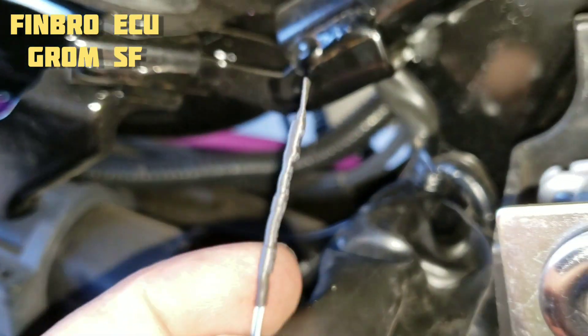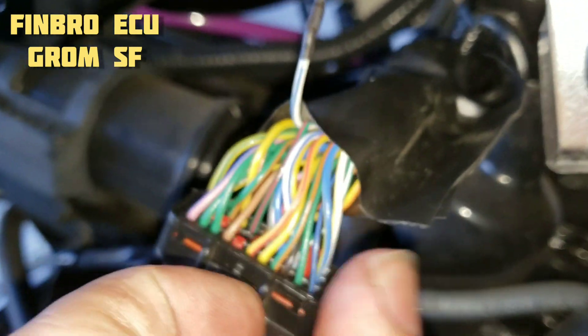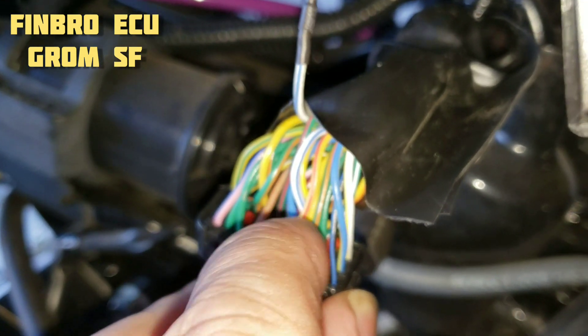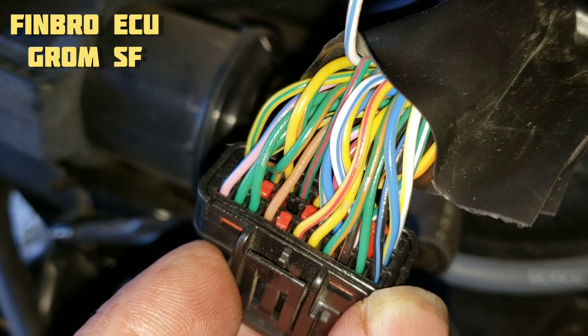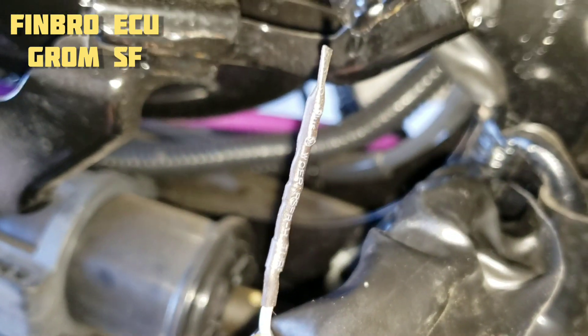We have it heat shrunk. We were able to pull the pin just by grabbing with some pliers and pulling slowly. It's right below where this red plug is in number seven. That empty slot you see there is where that blue and white wire came from. So you're gonna pull that out, heat shrink it up — you're not gonna use it.